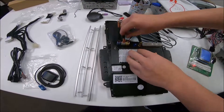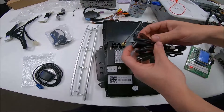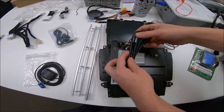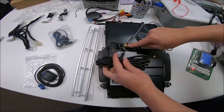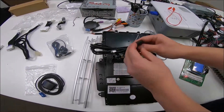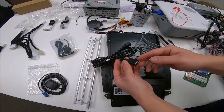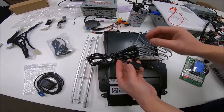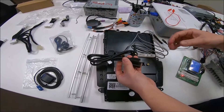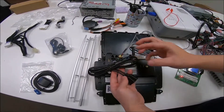To recap: the small speaker is connected. The white connector is not necessary, and the blue one is not necessary either. The last one is a USB connector — two grooves on the bottom and a groove on the right — and that goes right there. The two mandatory connectors are this brown one and this yellow one. There are two USB ports: one of them is labeled OTG, and the OTG one is for built-in wireless CarPlay. We have a video on how to hook that up. You'll need to keep these USB ports accessible — I'd recommend placing them in your glove compartment or shifter area.